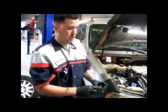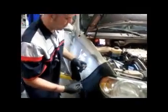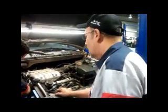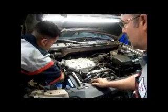If you do decide to keep this one, you would press it in at a press and put it back in as you put in the timing belt, just how you took it off. That pretty much covers the tensioner. But it is very important that you replace it, especially if it is leaking, because the timing belt tension is pretty tight and critical on this procedure. So keep that in mind when you are trying to budget your money — there is a point where you can try to cut too many corners.